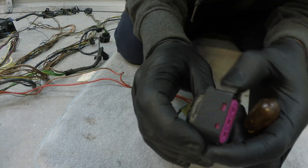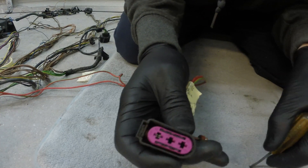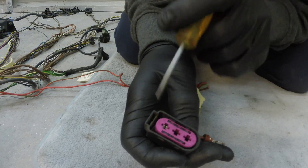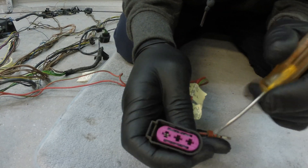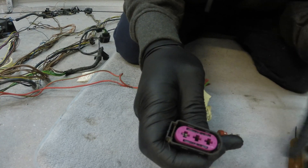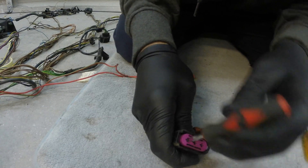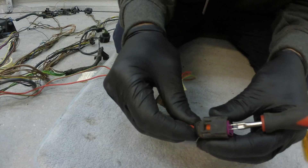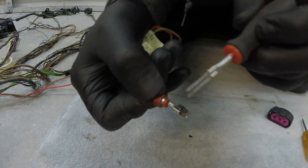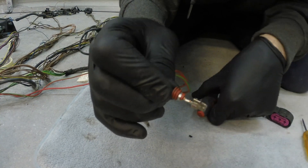So I wanted to show how I de-pin these wires. Every plug is going to have this purple lock on it and each one is going to be a little bit different. This one has an arrow right here telling you which direction you need to slide it to lock it - so you slide the other way to unlock it and you should hear it click. That moves everything over and unlocks the wiring. So now you can use your tools to de-pin it - these just press in, give it a jiggle to release the barbs that hold it in, and then your wiring should just pull out. You can see right here there's a barb and right here - so this tool just slides over it and presses those in to release it to pull it out.